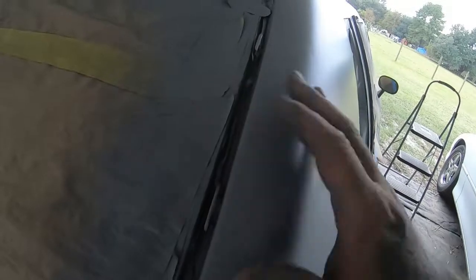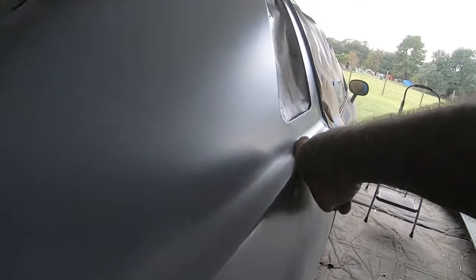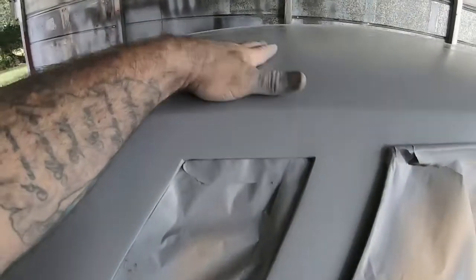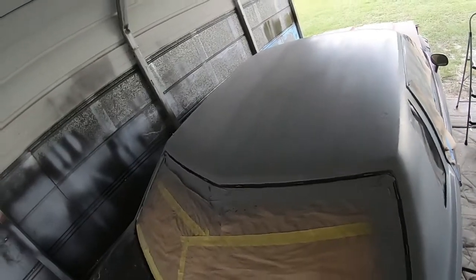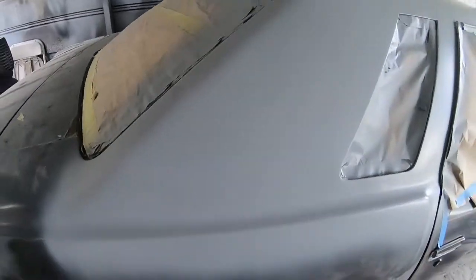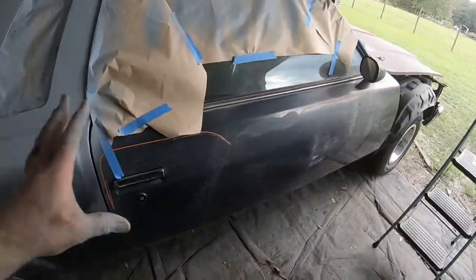The roof and side sail panels are complete - finally! But I can see right here this can use a little bit more sanding. I thought I had it feathered out nicely but I missed this spot here. The spots down here did pretty good. They're all going to be fixed up anyway. But this roof is finally finished - I got it completely done on both sides, primered. So now I can start working on these quarter panels and start progressing to the doors.